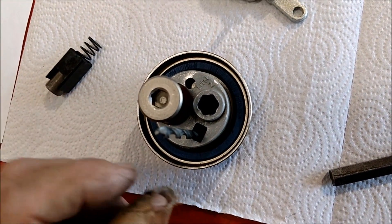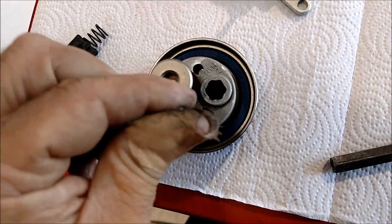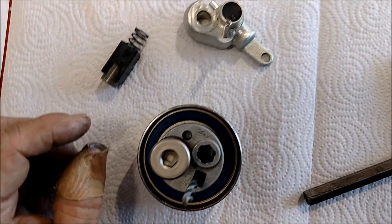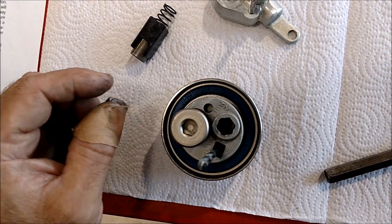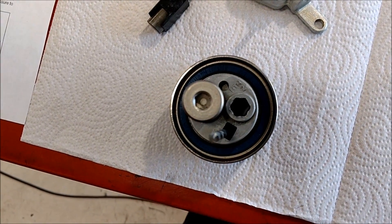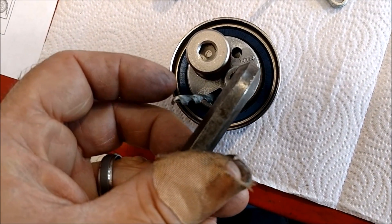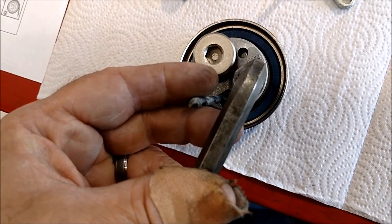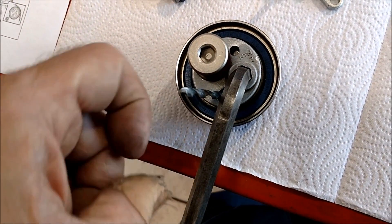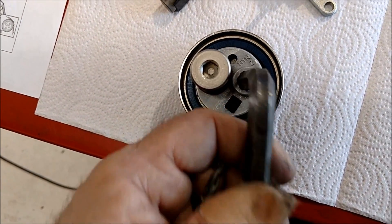Once you have it there, make sure that until you're completely ready, you do not just pull this out or let this fall out. Take care of it, or it could damage the tensioner if it suddenly snaps — and that's the same with any hydraulic tensioners. When your new belt's on and you're ready to go, and you've got your timing right and rechecked your marks, then slowly pull back on this ever so slightly until the tension is released on your 5mm or 3/16ths holding tool. Some people call it a grenade pin, because originally when you buy them new, they have a ring in there that you can pull like a grenade.